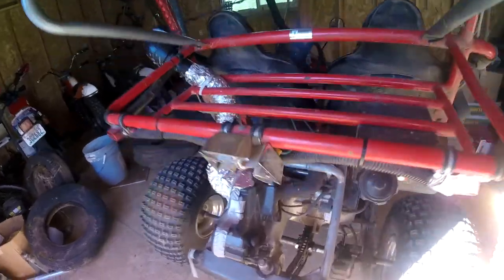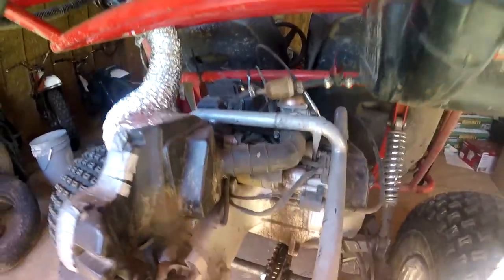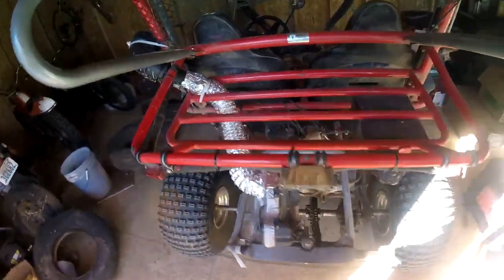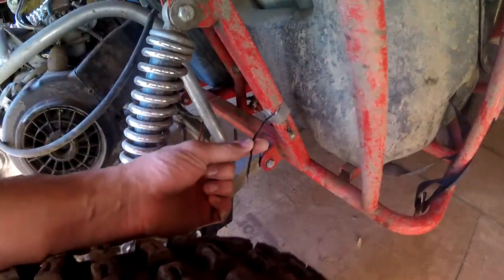At least I don't have fun fixing it, but it's easy. I've got to take apart the air filter assembly here and clean out the air filter, take the carburetor out and drown it in carburetor cleaner or gasoline or whatever. The light — as before mentioned — it's because the ground wire here broke.